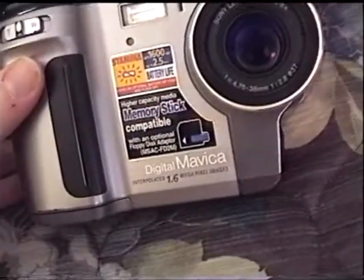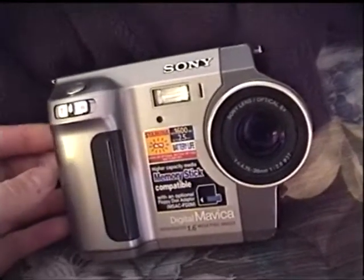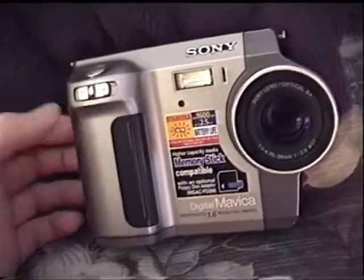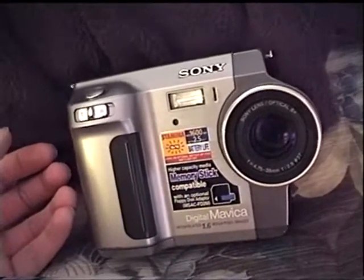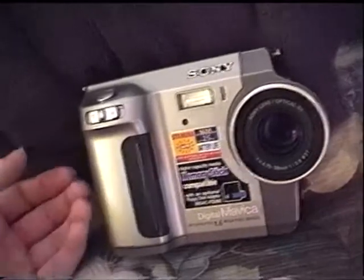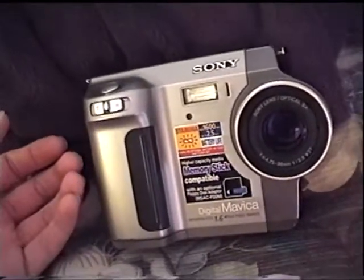And this does have the 4X floppy disk drive, so the drive spins the floppy disk at 4 times the normal floppy disk speed. I think a 3.5-inch floppy spins at 250 RPM, so that'd be 1,000 RPM, way faster than a floppy disk was ever designed to mechanically withstand.